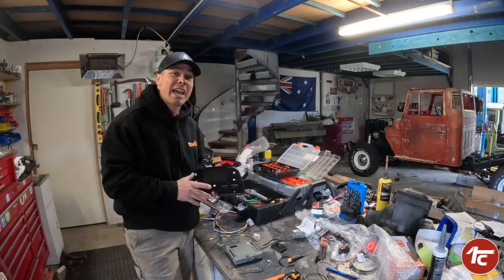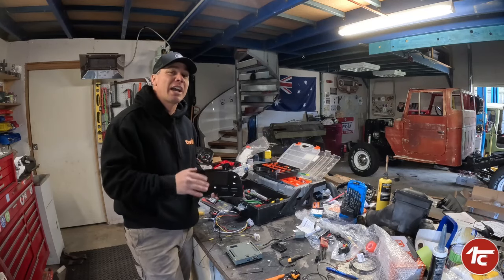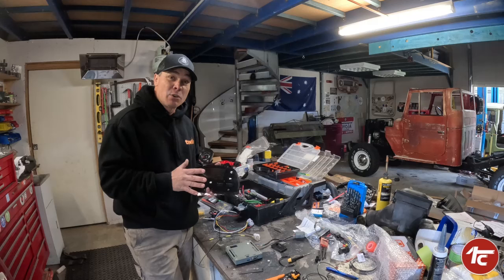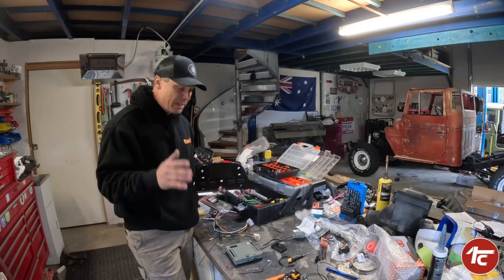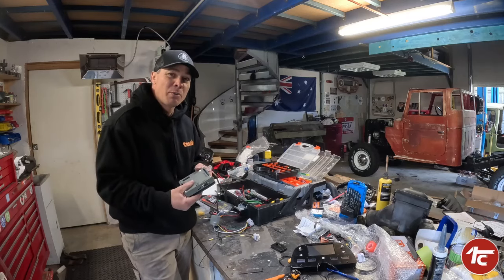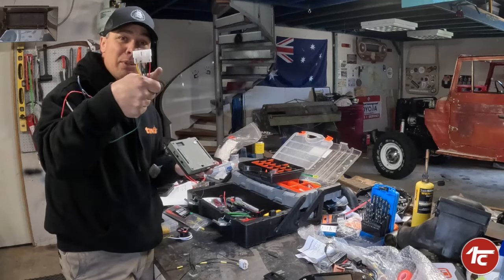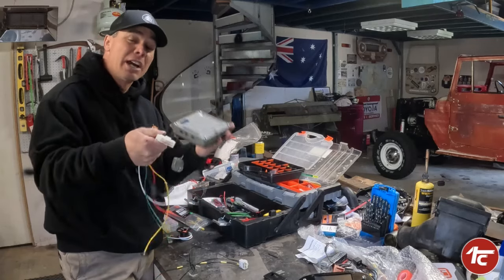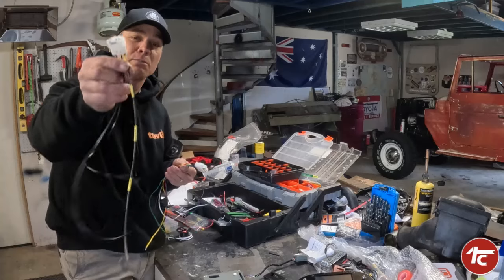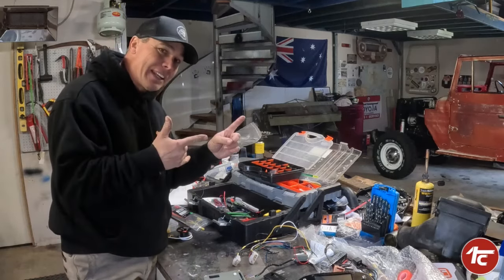We've unpacked all the NQ digital dash. The cool thing about these digital dashes is everything is calibratable. You can calibrate any sensor on your motor and car. I just had to calibrate the fuel, calibrate the oil pressure - the temperature is all running through the OBD. We also had to do a bit of calibration for the speed. Now what I'm doing this time is wiring it all into the brains unit - I call it the brains box. I'm making up wiring harnesses that plug into the box and stay there, so if I ever need to pull out the brains all I need to do is unplug and pull the whole system out. Plug it straight back in - plug and play. You can use different colour wires, label them, or put little heat shrinks on them to identify them.